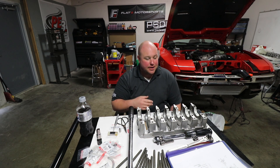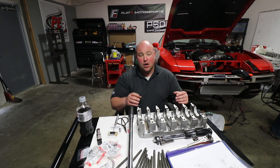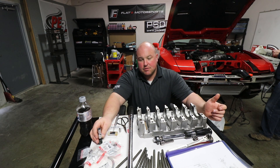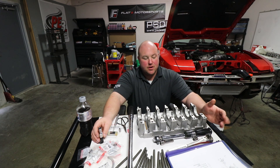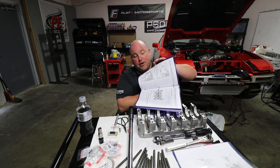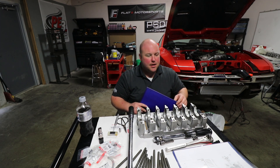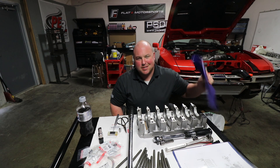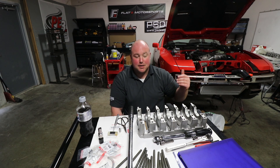With all that out of the way, let's jump back into this. I did a little bit of work off camera — I went through and measured all of the oil clearances for my bearings. One of the main issues with this engine, and one of the things that makes me nervous about building it, is that it's really hard to find published specifications. I have a factory service manual right here with lots of great info, but nothing about oil clearances or bearing tolerances — basically everything tells you to just replace with factory Porsche parts, so it's not meant for a project like this.